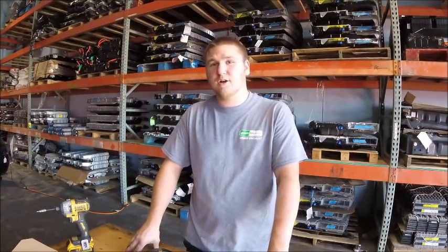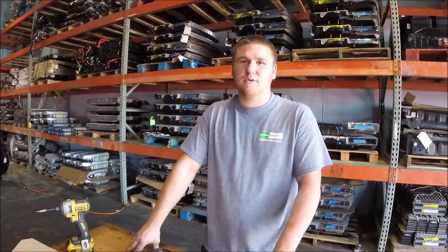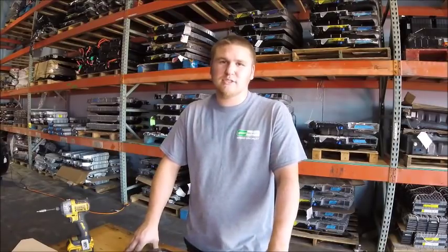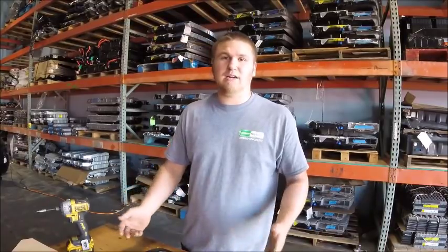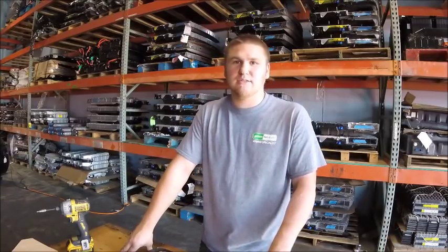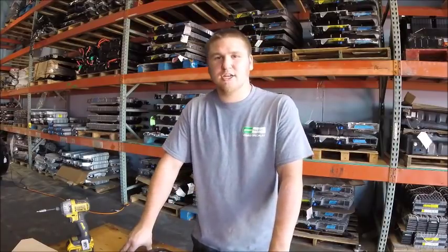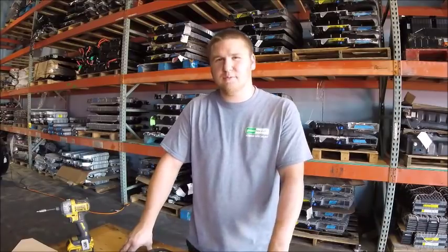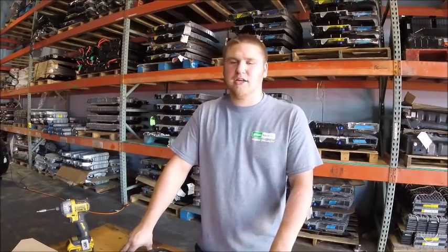I would say this one's going to go up on eBay, again, selling the modules for other uses, but we'll have to figure out what we do with the damaged batteries first. And again, the one with 2 modules, most likely we're going to tear it down because there's more to recycle, and we have a recycler that can take those type of cells, whereas the ones that are either more complete or complete, those will probably end up on eBay. And again, we'll just double check the corrosion, double check each individual cell, just to verify that they're in good condition to resell. The other thing I would want to do is a capacity check,